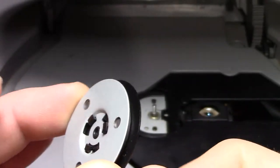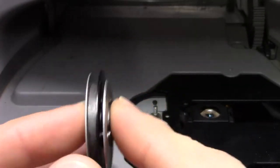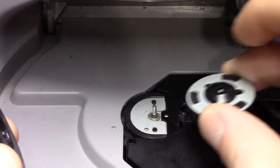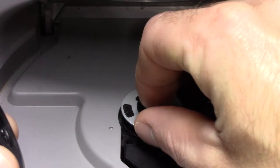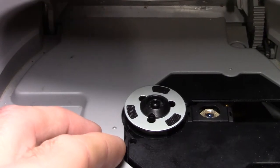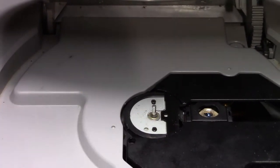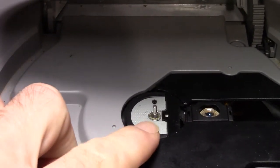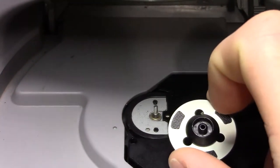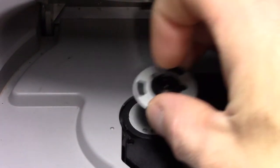In those, here's your spindle, and you've got the magnet that has to go down on top of it. I had this in there and it did work. It was kind of a pain in the butt — basically when you're setting the spindle down on top of the motor, you've got to gauge the depth of it. You want just a little bit of this protruding from the top of the spindle. You don't want it completely down or else it kind of rubs, and if you leave it all the way up the laser cannot read the disc.